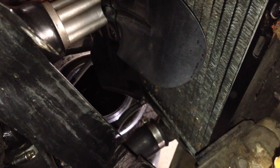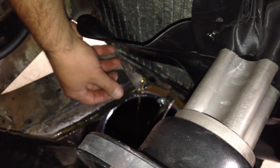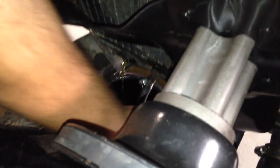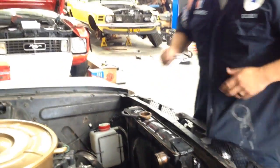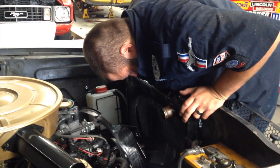My next step, I'm going to do the lower hose here. We're still draining a little bit out of the radiator so we're going to leave that be. Pretty much done with draining the coolant. So that's been undone. I'm going to undo the two transmission coolant lines here as soon as the coolant's done. Because I'm going to change the pan — you do not mix lubricants with coolant, that is a big no-no. I may or may not have to pull the fan; I've been trying to get these out without having to do that. We shall see.